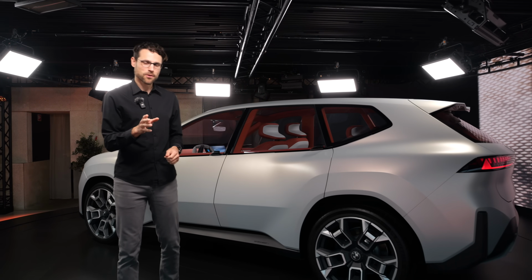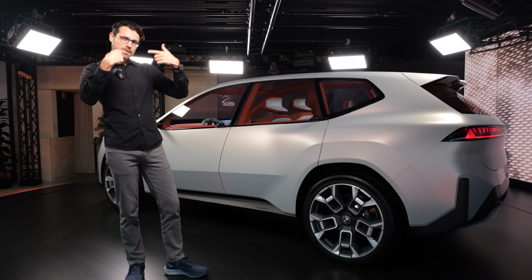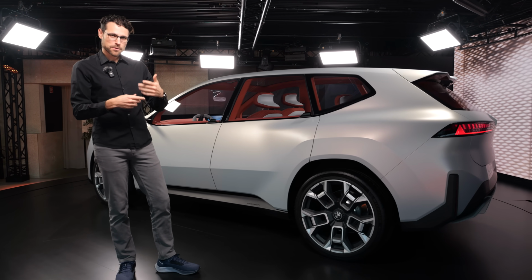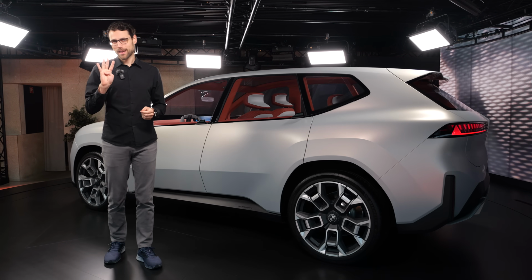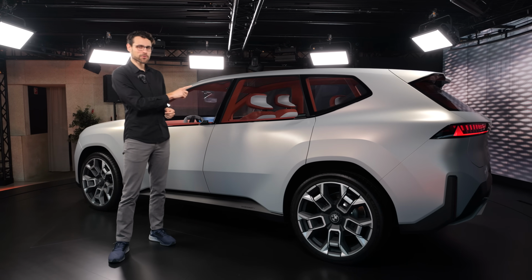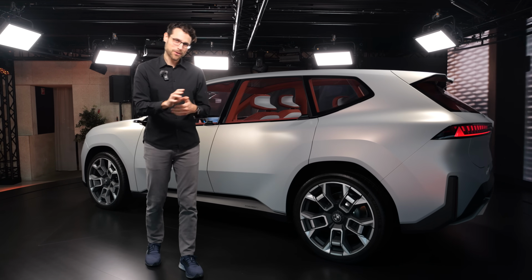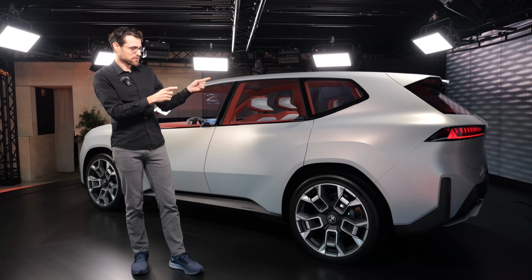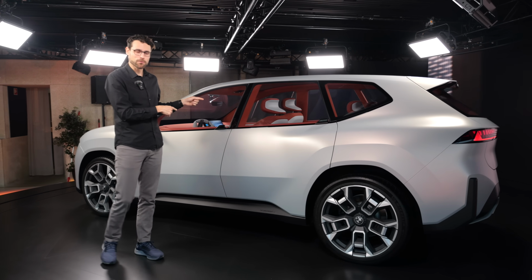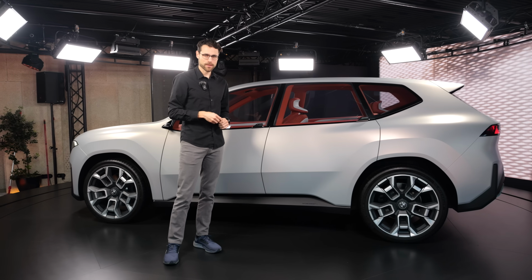But what's very interesting, I gathered with some deep talks yesterday, is the new architecture behind the vehicle and also their electronic control units are able also to control 4 electric motors. So 1 electric motor per wheel. So it is possible that with this new platform we'll also have a version, maybe like an electric M version, which has indeed 4 electric motors for the whole vehicle, 1 per wheel. And then of course you have the perfect torque vectoring.